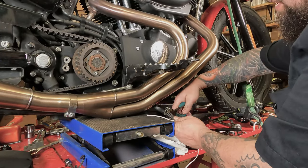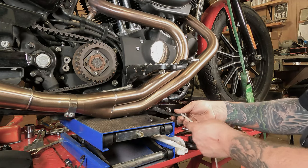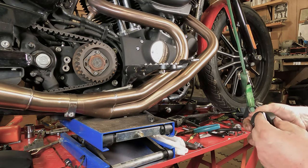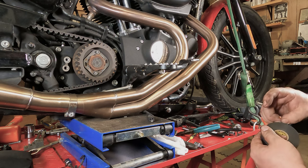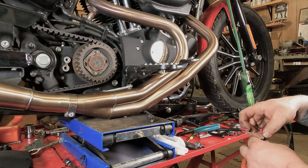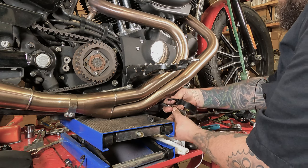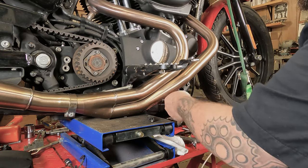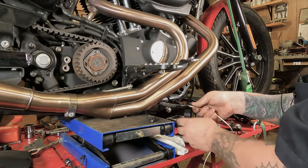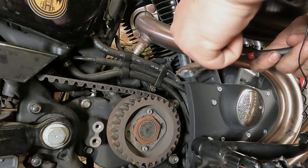We're going to cut the plug off of this thing. I was hoping I could pull the outer sheathing off, but I can't. Then we're going to take our pull wire and we're going to electrical tape it onto here. The idea behind this is then when we go to pull the new wire through, we can use this as a little bit of a tug wire. Might need an assistant, but we're going to wrap it around there and tape her up with some electrical tape. Tape generously.